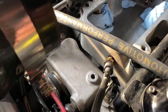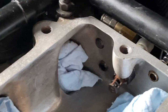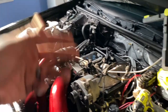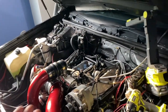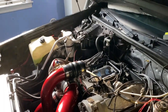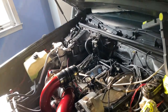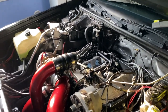I went ahead and drilled the remaining holes and installed the fittings. As you can see, I have one blocked off, one going to my MAP sensor — you can actually see the fitting right behind it — and another one going to my cruise control and AC line. The one I plugged is for future expansion, so I don't have to go through all of this again. I can just remove the coil, get in there with a 7/16, take out that plug, and put whatever fitting I need — or even feed a vacuum block. The methanol signal could also come off of that.